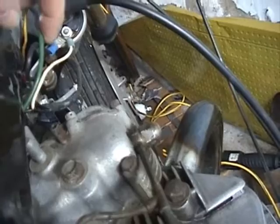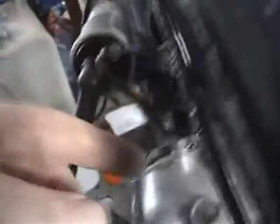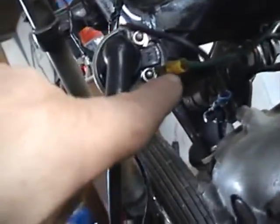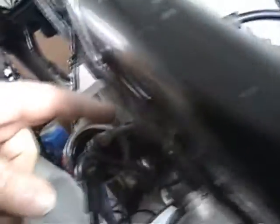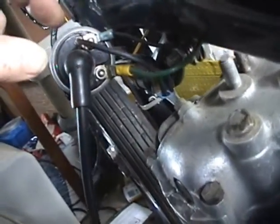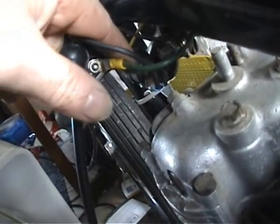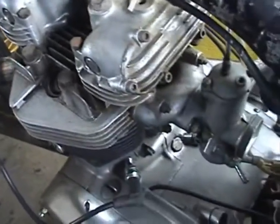Underneath and hooking up to that rectifier. I've got the negative green wire coming across, going to negative on this coil. I've got the positive — that's the other points. And this positive is going to the condenser, which is being grounded out. So hopefully I've got it wired right.